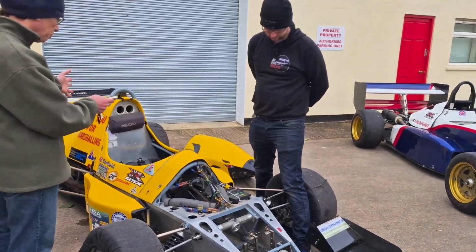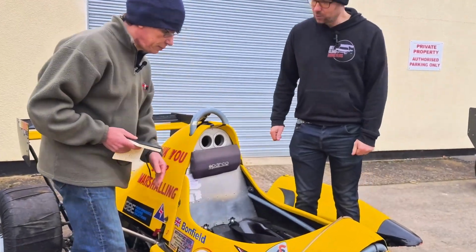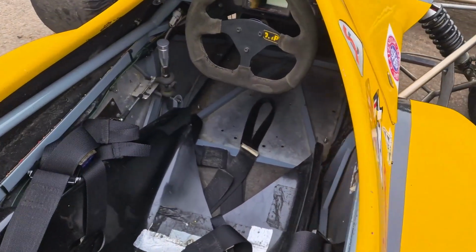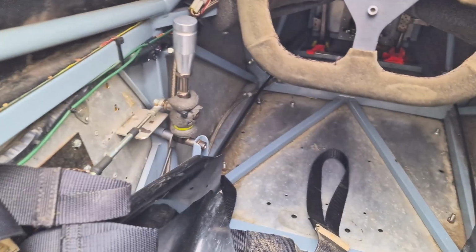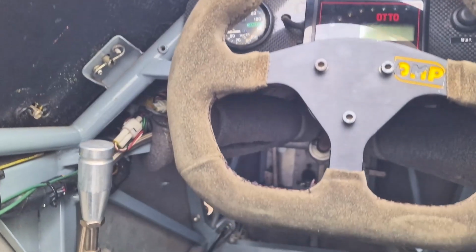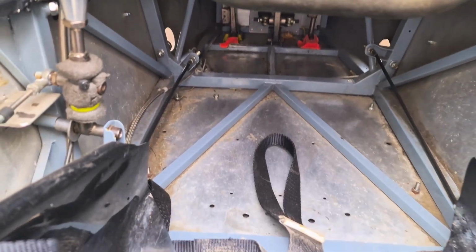Oh, fantastic. Well, let's move back to the cockpit. Is that a fiberglass seat that we've got there? That is a fiberglass seat out of an old Formula Ford. And I presume that's a sequential shift on the left-hand side? Yeah, it's the standard setup with the bike, so for us it is one forward and then five back. Have you bothered with a reverse box at all? There is no reverse gear on this one. For hill climbing, it's not required. The circuit cars do have a reverse, which is a gear drive off the diff.